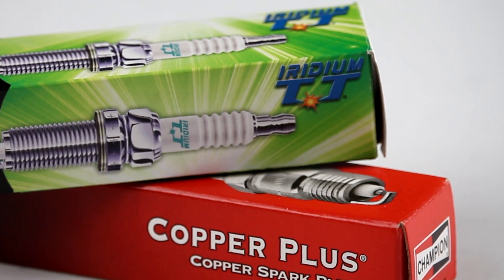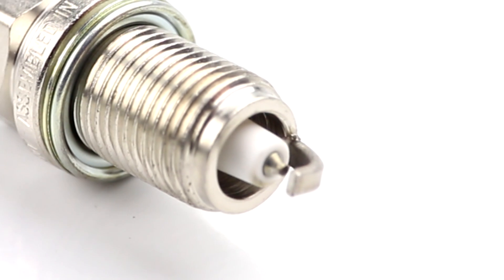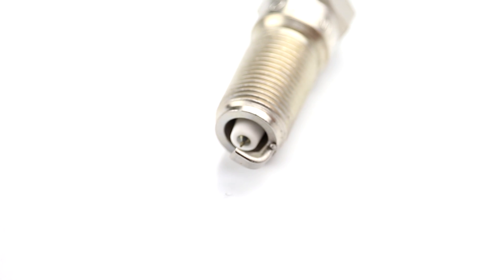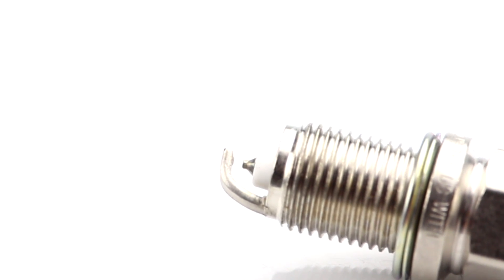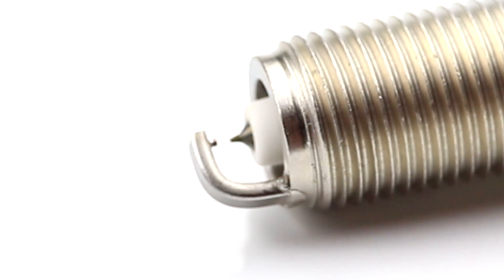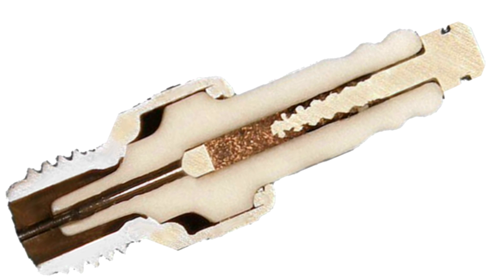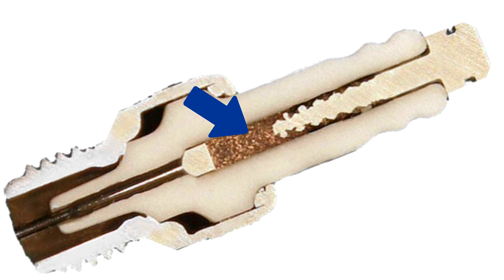Most spark plugs with different material names are just copper plugs with extra materials on the electrodes. Platinum spark plugs use a tip of platinum at the center electrode to increase the lifespan of that electrode, while the double platinum variant uses platinum on the ground electrode as well. Platinum center electrodes tend to be smaller than what's found on basic copper plugs. Iridium spark plugs take the lifespan improvements of platinum even further thanks to their higher melting point and hardness. The center electrode tip of iridium plugs is also the thinnest, and some iridium plugs come with platinum ground electrodes. Spark plugs for road-going vehicles have some built-in electrical resistance in order to help reduce ignition system radio interference.